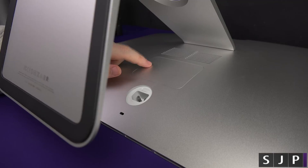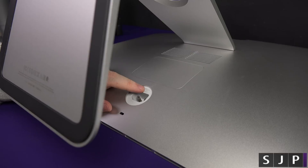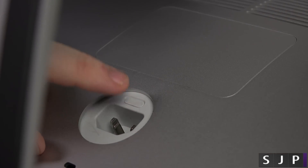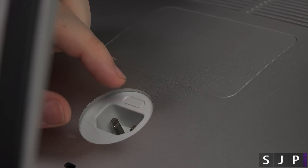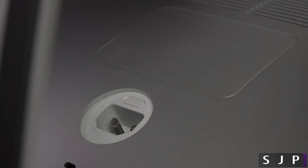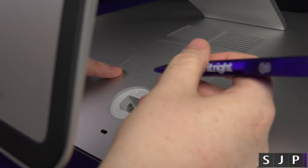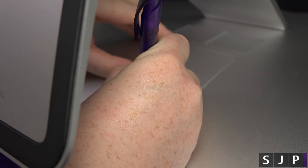This is your door at the back — this is where we're going to put the RAM inside. Underneath the power socket there's a little button. We'll zoom in a little bit for you. You can see there's a little button. Once you press that in, this pops up. It's a little hard to press with your finger, so you want to just get a pen or something and push it down.